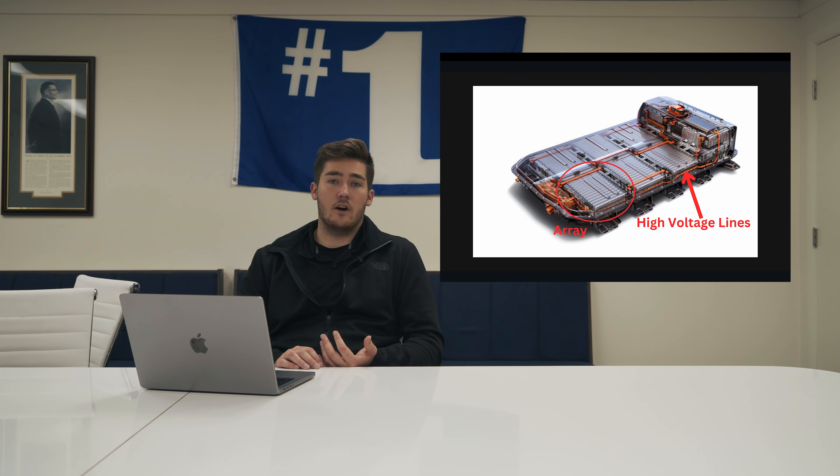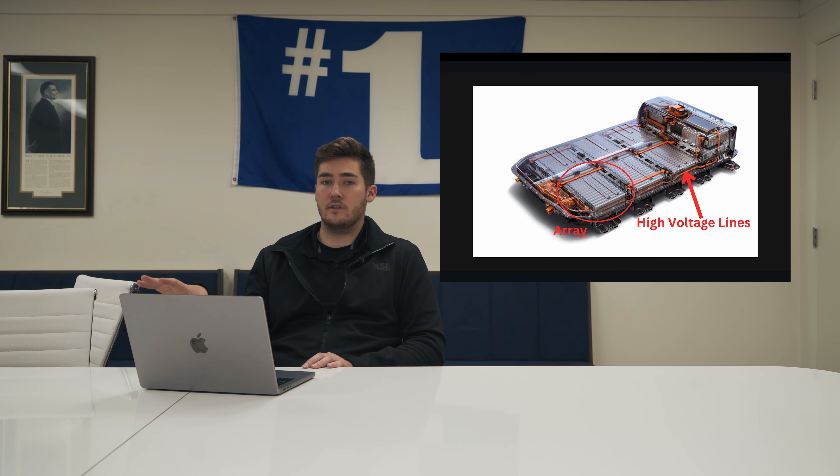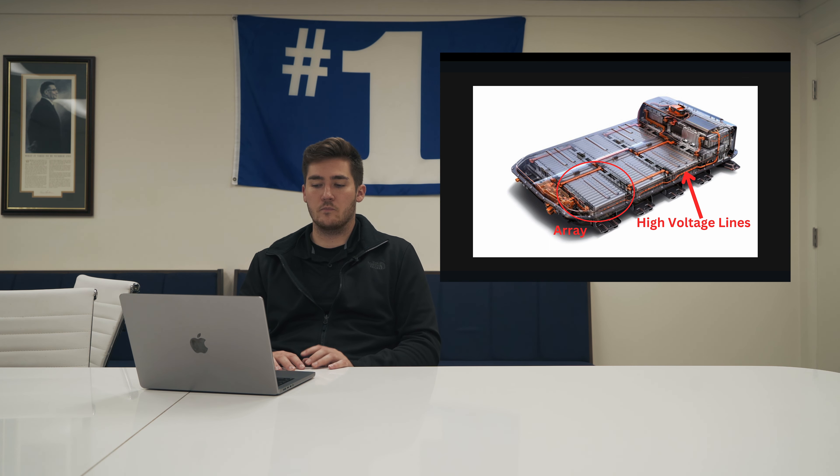These things do get very hot. Take your phone, for example — when you're plugged in, your phone heats up. So there needs to be that heat exchange to cool these batteries down. You replace two of these arrays at a time. Once they're replaced, you have to build the battery life. Say your battery is at 70% — the new arrays have to be charged to match that battery life, and Ford technicians have a computer system that will do that for them.